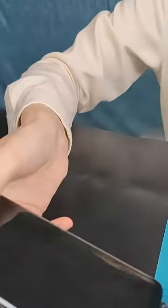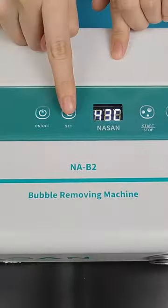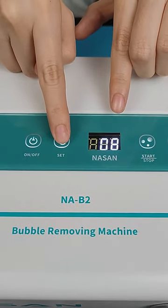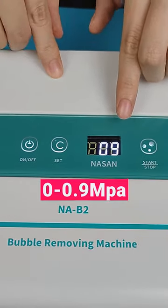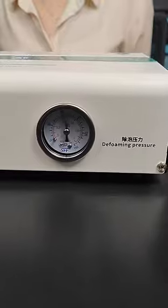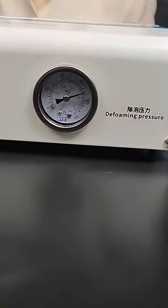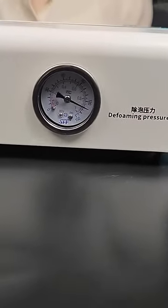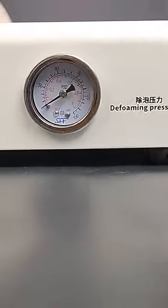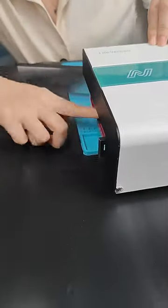This makes it possible to remove bubbles on very curved screens. Give it a long press — we can change it to 0.9 MPa. Double-click, and now you can see the pressure is 0.9 MPa. We just wait until it is done, and the bubbles in the corner are clean.